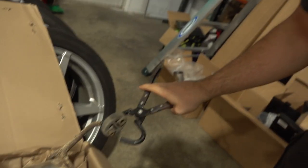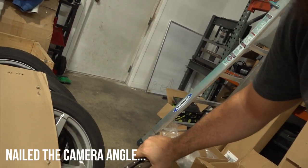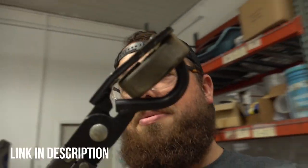One thing I thought would be helpful to point out — these specialty exhaust pliers are designed to actually help remove the rubbers here. These can be a real pain to remove. Basically this plier sneaks in behind it and then you just squeeze here and it'll pull the rubber off, so you don't have to deal with fighting it. Those can sometimes really be a pain. I'll include a link in the description for this.